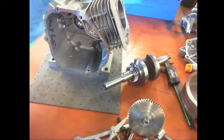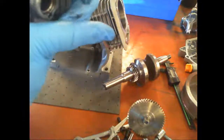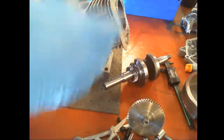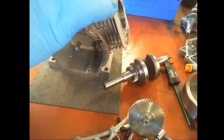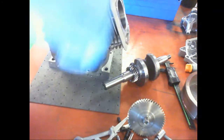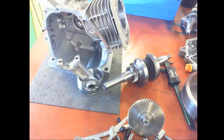All right. And then I'm going to look at my oil rings. Okay, there's a gap right there for one of the oil rings. That's not near any of the compression. And there's another one on the opposite side. So there we go. So all those gaps, you don't want them lined up because that means oil can come all the way through all those gaps or compression, go past it and you lose compression. Okay? I'm going to wipe this down a little bit.